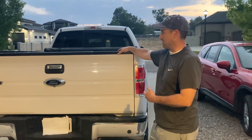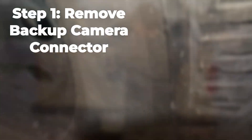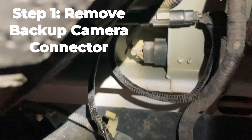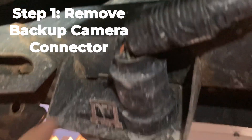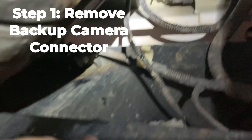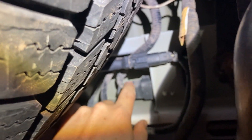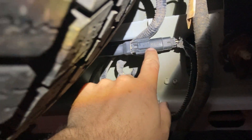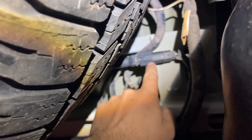We've got our 2014 F-150 and we're going to remove the tailgate. Up underneath, here's the spare tire and the backup camera coming off the tire. Here's the trailer connector — the backup camera is located right here. You've got to remove this clip here and pull that out and feed it through the tailgate before you take the tailgate off.